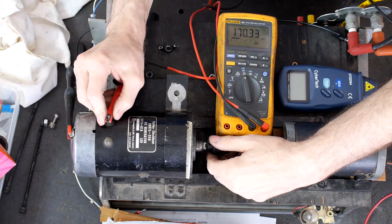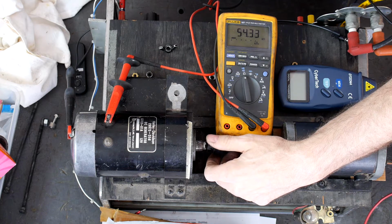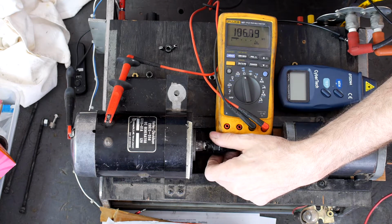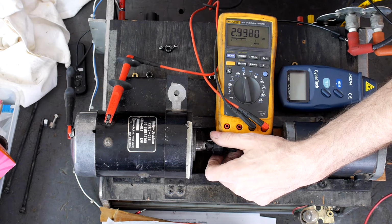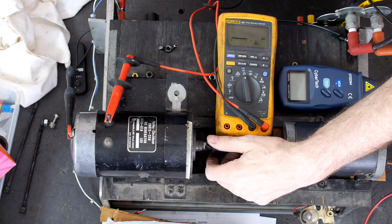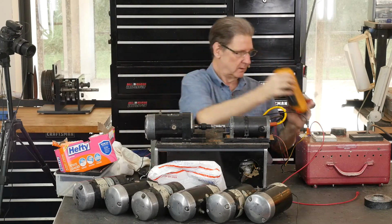Boy, this thing's just not doing any kind of good. It wasn't this bad when, it had a couple of places where it was like 40 ohms or 60 ohms. This guy isn't happy to be that high, right? And this, like I say, they didn't have ohm meters this good. 2 kiloohms, so that's getting a little better. 57 kiloohms. It's not the 1, 2, 3 ohms that you want to see, okay? So that's an issue.